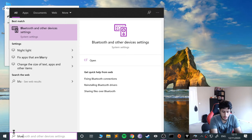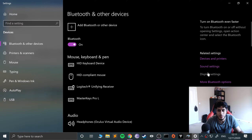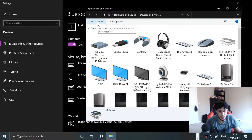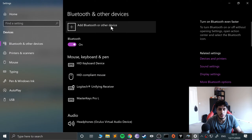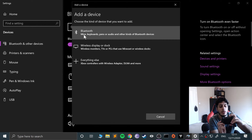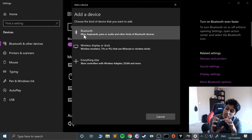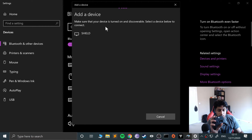What you want to do is search for 'Bluetooth and other devices'. You can use that option or go to Devices and Printers and use the add device option — totally up to you. I'm going to use 'Add Bluetooth or other device'. Before I do that, there's a sync button at the top just next to the USB Type-C port. If you keep that pressed for a few seconds, you'll go into sync mode.